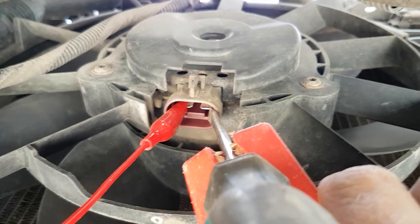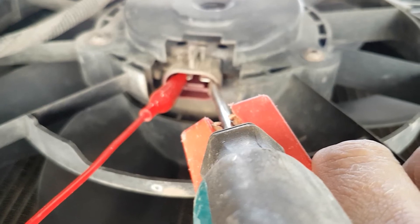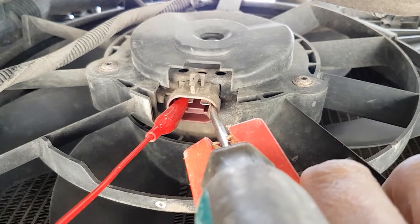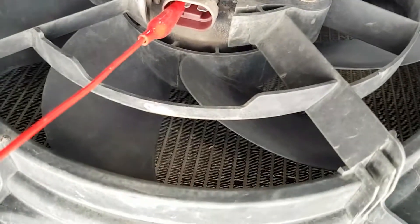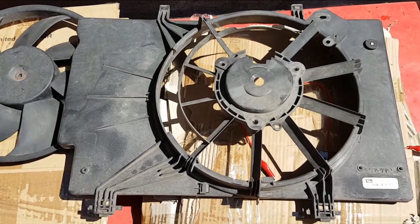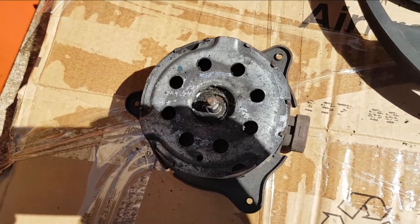You didn't really notice it except the car smells of oil - it gets hot and smells oily, but there's no warning light inside the car, and the air conditioning's not working. The customer has been running around in this thing with no fan - it was overheating, so there you go, the fan is gone. There we are - the fan assembly, the baffle plate and fan holder, the fan blade, and the offending fan motor down there.